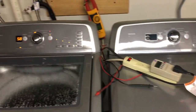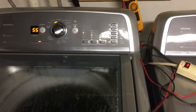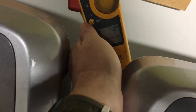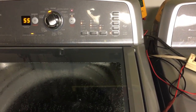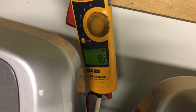Pulling back to show the setup briefly. The camera battery was low, so there was a brief cut. The inrush meter is back on and I just caught 8.2 amps just in time. So the wash cycle — the agitator — is now running. We've seen inrush readings of 8.7, 8.7, and now 8.2 amps, which is pretty consistent throughout the wash cycle.